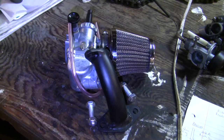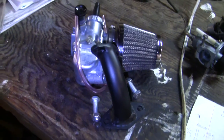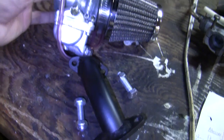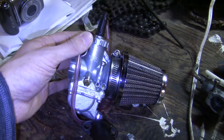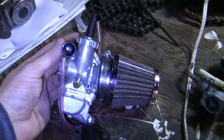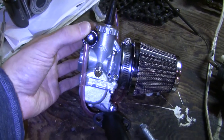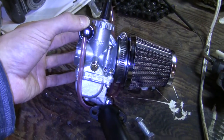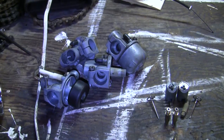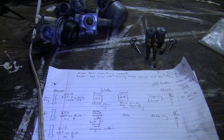In the coming weeks, I'm going to be ditching the 14 Bing setup on that Maxi and running this — a Mikuni VM20 and a Weekends intake for it. Realistically, once you get big enough with the size of your kit and how much power it makes, you really want to switch to a multi-circuit carb like this one. This allows you to just swap out jets or screws and tune for different throttle positions. But I suppose it is in the spirit of mopeds to mess around with Bings, and just like the Mikuni or a PHBG, we can also tune different throttle ranges with the Bing — instead of changing out jets or adjusting a mixture screw, we're going to swap out parts.